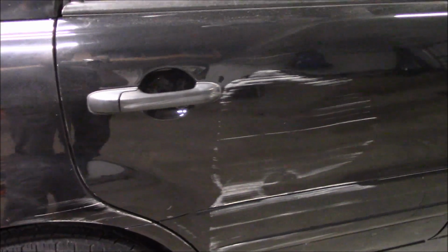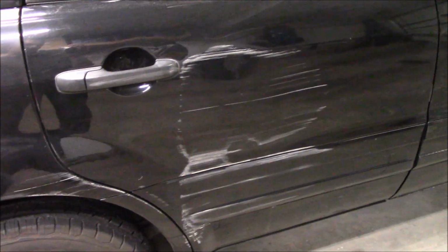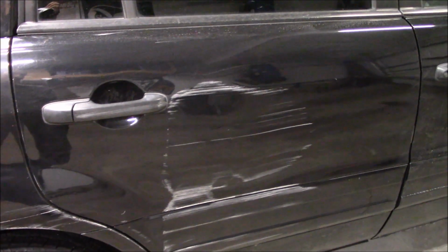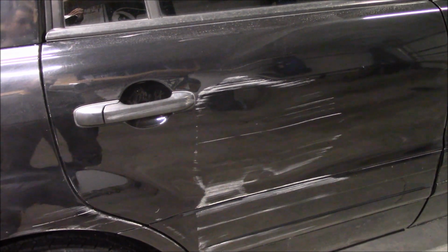I mean, because you look, those little dents are way more minimal than they were before. And if I were to repair these, that would take such a minor bit of filler, it wouldn't even take a little more than glazing putty. So yeah, the little machine works. It's probably worth it if you're looking at something. For a big major door sized dent like this, it's going to get you close enough to where you can body work and use a heck of a lot less filler. So yeah, I'm glad I bought it. And I'm glad I spent the time today learning to use it.